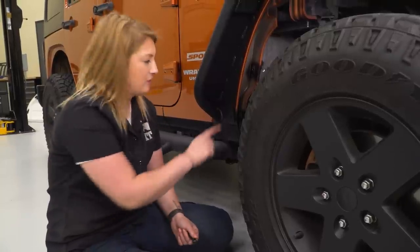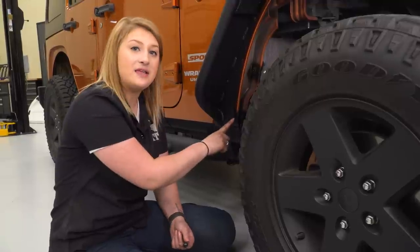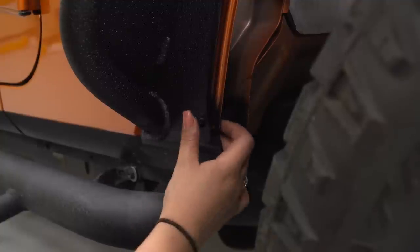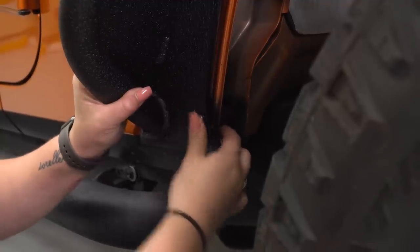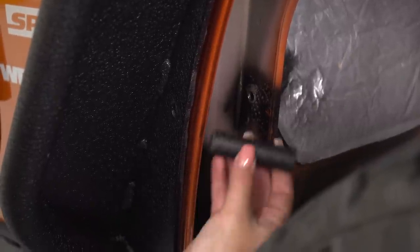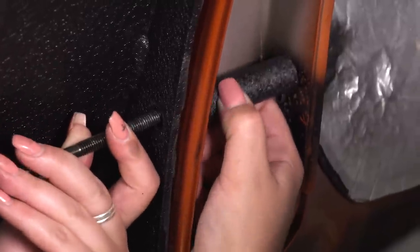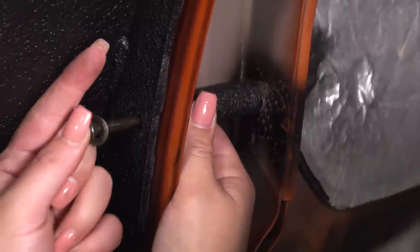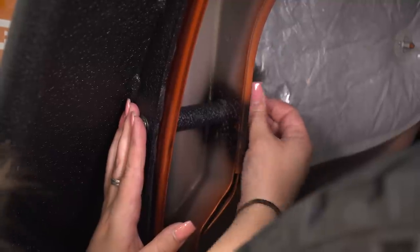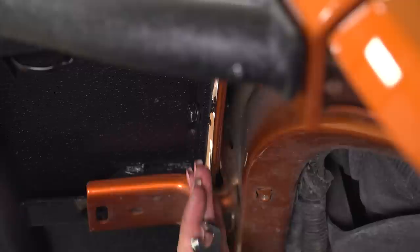In order to install the hardware for these two bottom bolt holes, you will need to drill two 3/8-inch holes directly behind these bolt holes in the inner body. Once you push this through, you can attach the washer and the lock nut on the back of it and that will hold our fender in place while we bolt in everything else. Our last bolt to attach uses the longer sleeve — insert that in between the two bolt holes and push the bolt through. You might have to push up on the fender to get everything lined up. Then attach your washer and your lock nut on the back of that. Now we can tighten everything down with a 13-millimeter wrench and a 13-millimeter swivel.